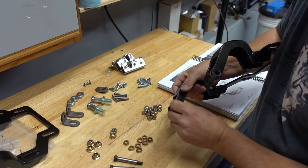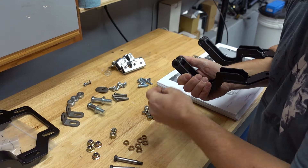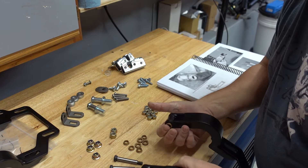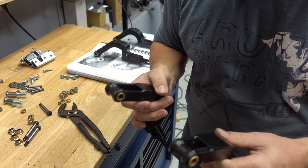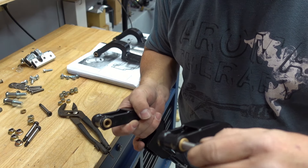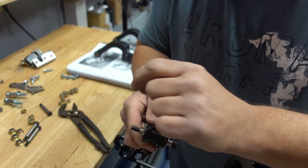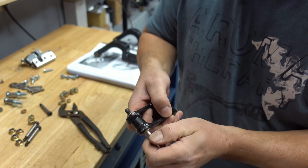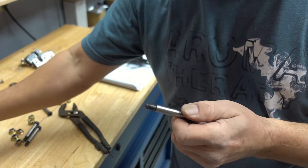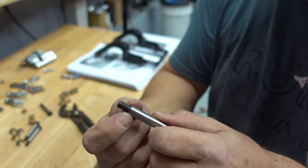We'll get these little bushings put in, which is probably going to take a little gentle persuasion. Here's a quick tip that I figured out after I had some difficulties getting these bolts in: try to get the bolts in through the bushings before you try to get it in place, because the bushings might be just a little bit askew. If you get the bolt in while you have this out, you can actually work them so that they're aligned — it makes it a little bit easier. Now, the book also says you can taper the edge so that it's a little easier to get in. That's probably good advice.